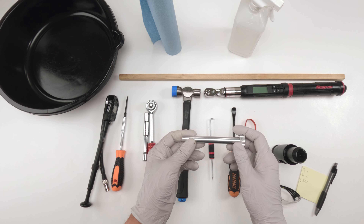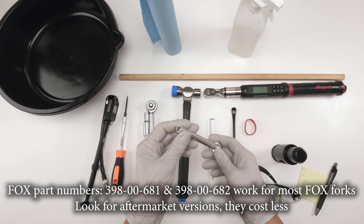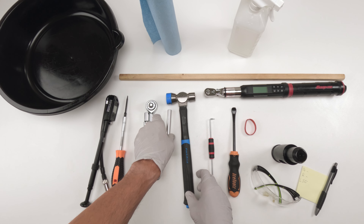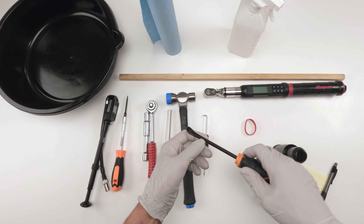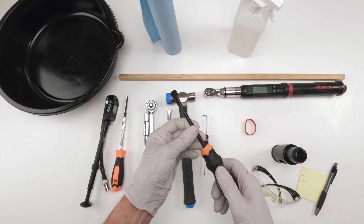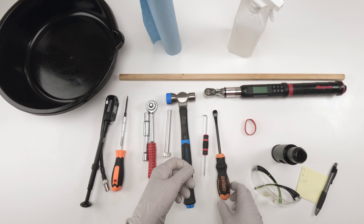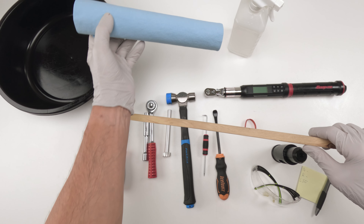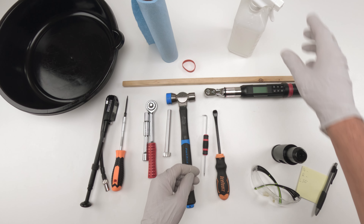Once we remove the screws, we want to tap out the shafts from the lower leg. This Fox tool — this is an aftermarket version — Fox's is super expensive, this is about a third of the price. We can use this with a mallet to tap out the shafts from the lower boots. Then we're going to separate the lower boots, grab our pick, take out our foam rings, and take out the wipers. I love this Ice Tools tire lever — any tire lever with a nice plastic coating works great, because it's much less likely to chip the paint on the boot.